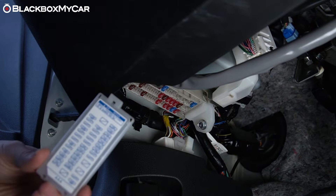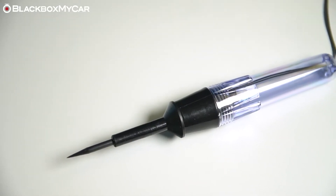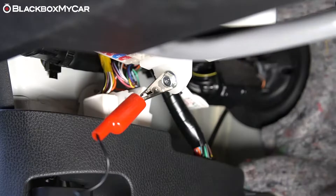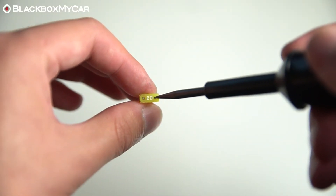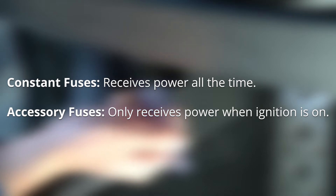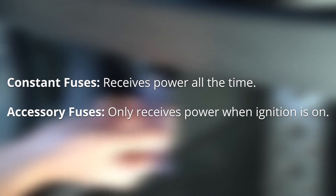What we recommend would be to hardwire the NEO directly to your vehicle's fuse box. Fuses that can be used will vary from car to car, so you will need to test your fuses using a circuit tester. These circuit testers need to be grounded first and work by lighting up if you poke them in the openings on the fuses. Fuses that cause the tester to light up when the car is on and continue to light up when the car is off are considered constant fuses, while fuses that light up only when the car is turned on are ACC or accessory fuses.